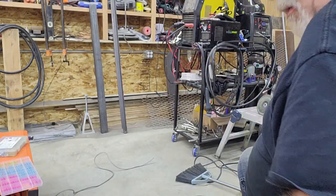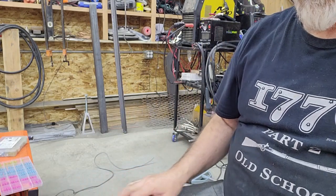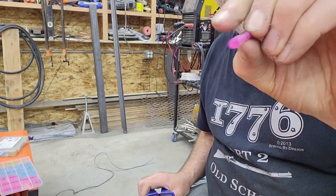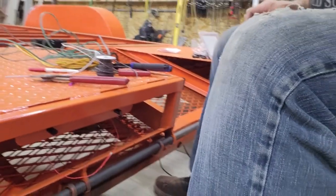So the point there is, if you're going to use insulated butt connectors or ring ends, and it doesn't really matter what kind of connector they are, if they're the insulated style like these, with heat shrink on them, use the correct crimper. Otherwise, again, you'll be giving yourself a right area where you're going to get some corrosion and have a failed connection.